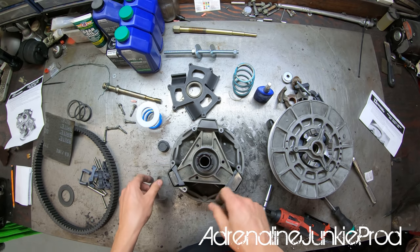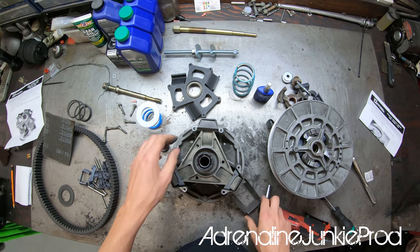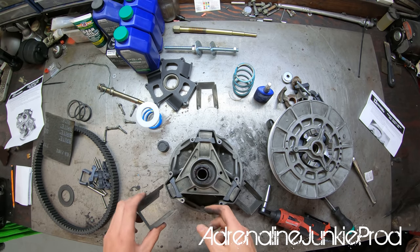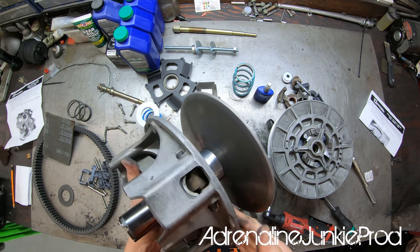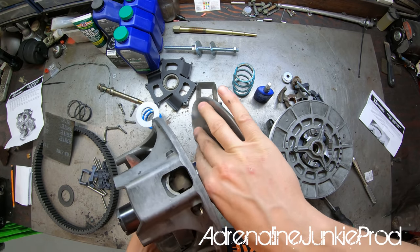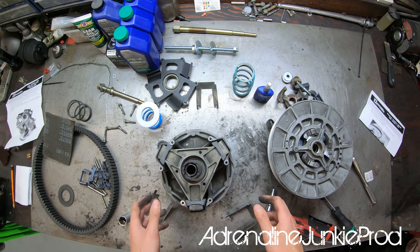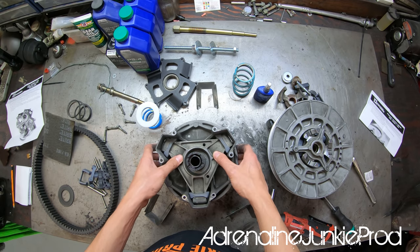The super sliders show minor scuffing but no ridges — looking pretty good. Also a good time to inspect the needle bearing inside the clutch — make sure it's rotating nicely or it leads to belt wear. I replaced this one last year but it does sound a little noisy. Truth is I should probably replace it again, but I don't have one — I'll order a new one from the dealership soon.